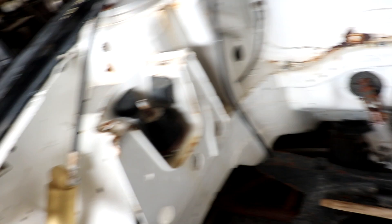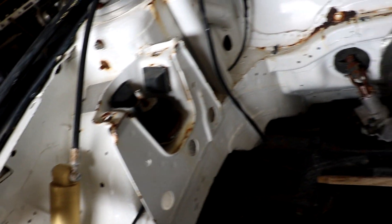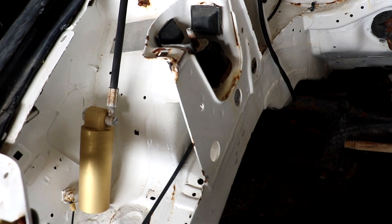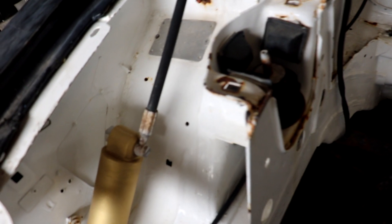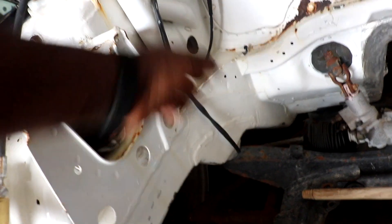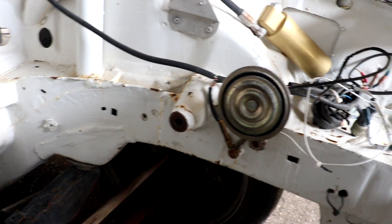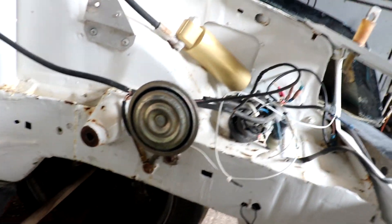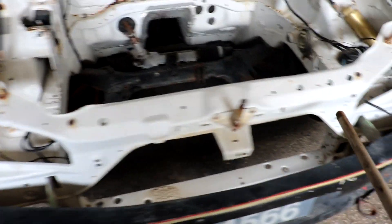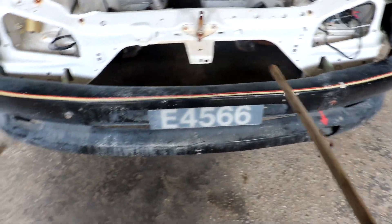See what needs to be altered or moved or whatever else. I think the gearbox will be going to this side and the engine to this side, so we'll have to look at the mounting positions and make the mounts and brackets to suit. Make sure this car is going to move in there. Looking at it also, the front of the chassis seems like it could be removed — a couple of bolts there and this whole front piece could be taken off. So what we'll do is remove the bumper and see if we get this off, so I can at least access the whole front of the vehicle. That way the engine will be able to just go forward and down rather than drop in.